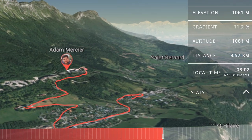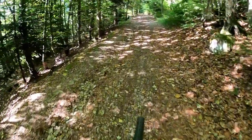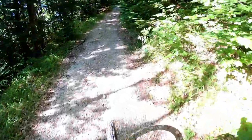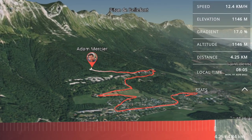Today, a new video on the channel. I'm riding the LMX56 development bike — this is one of the pre-serial bikes, but still running the old motor. The motor has straight-cut gears, so they are quite noisy, like a rally car gearbox. For the serial bike, we have helical-cut gears coming, and it will also be running with a belt. This one is with the chain, so quite a big difference on the noise.